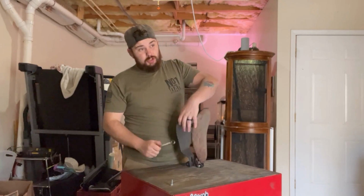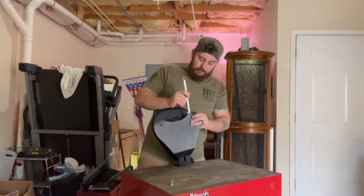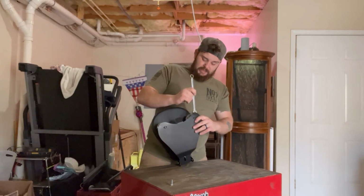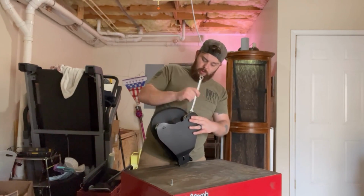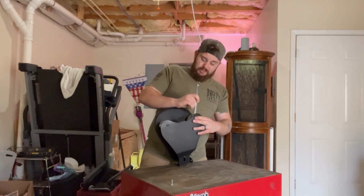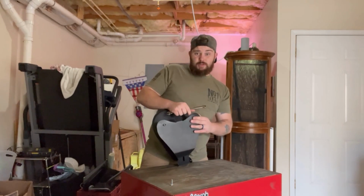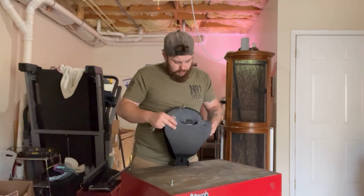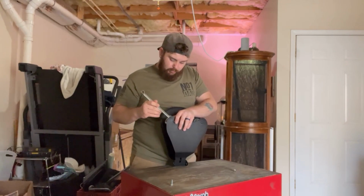They're gonna be a 1/2 inch. I highly suggest if you have a ratcheting wrench and can get it in there, do that. If not, as you're taking this apart, it is easier, I personally believe, to get the bottoms on than it is the tops. So what I would do is take off the bottom ones before I take off the ones on top of the springs. So the ones that are attached to the plates, pop those off. There's one. Let's get that nut. Let's go to the next one.